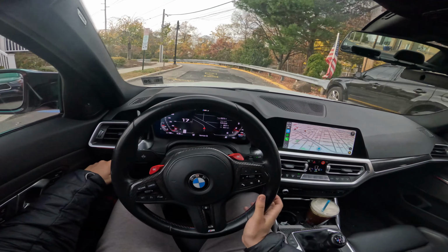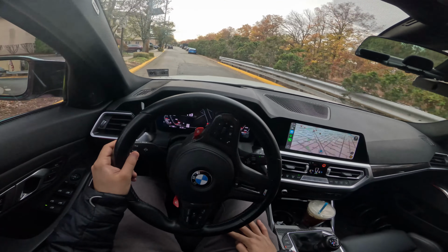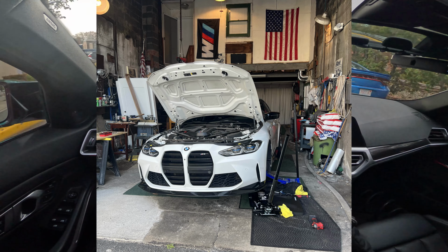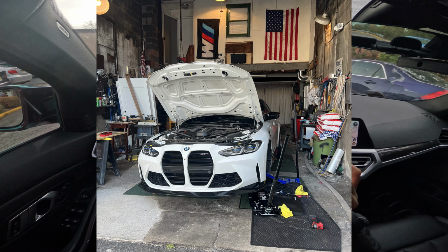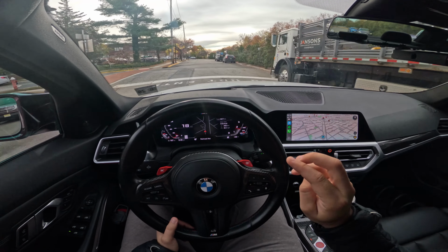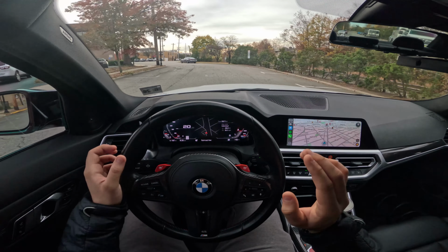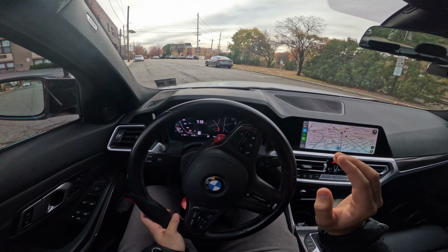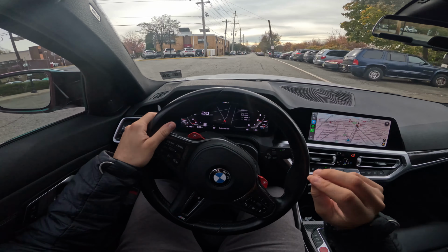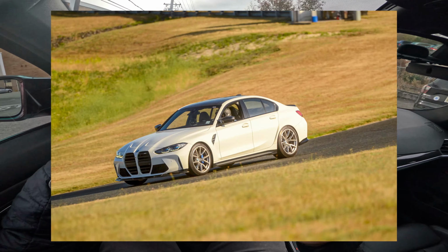When I did the install of springs with Eric, my neighbor, we put it at a spot we thought would be perfect, and it ended up being pretty much to the T, like track spec ready. We had about minus 3.2, minus 3.3 camber in the front. The rear was around the same. I mean, we had a lot of toe, which is obviously not good for tire life, but when I was chucking that car around just straight from dropping the car, it felt so good. Guys, it felt so good, and I'm so excited to have that back, especially with a more proper dedicated tire. This car is going to be flying.